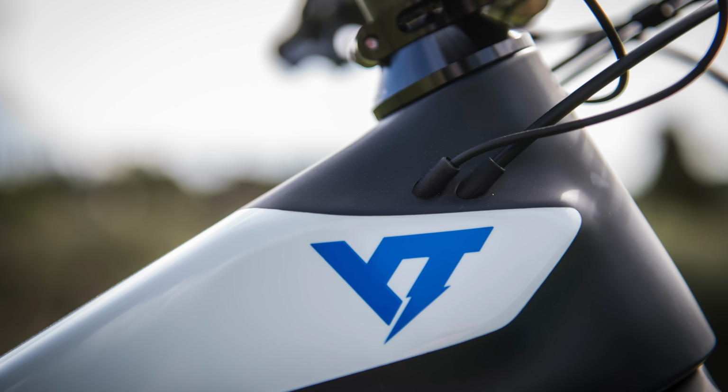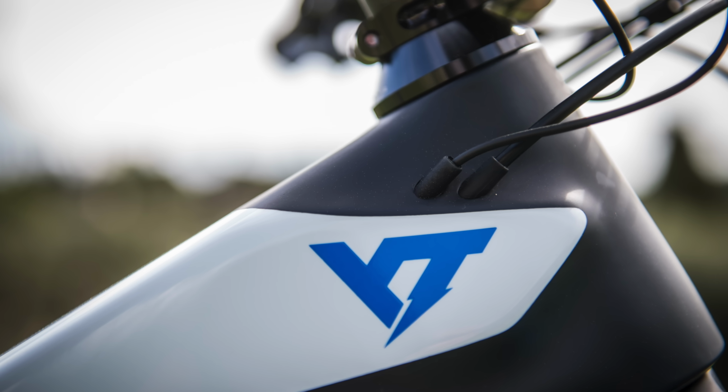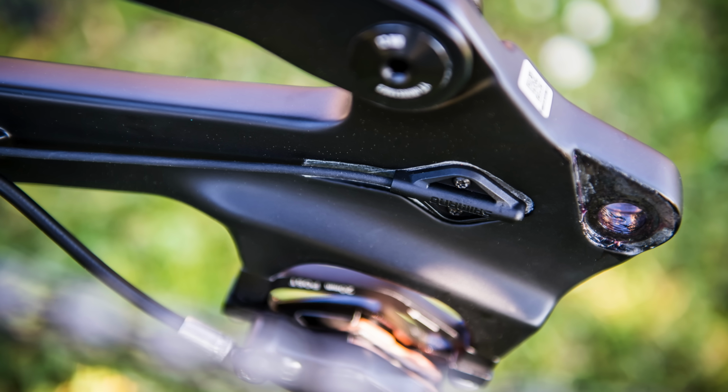Yes. So first, service is a huge topic. We had the service issue from the beginning in our design brief, because we go direct. So it's not all about the electronic issues you could have. It's also mechanical things. And we now have 10 years of experience, and we know what our consumers can handle and what not. And if we have a mechanical issue, maybe with a hydraulic system like a brake or shifting cable, whatever, it was clear the bike needs to be designed so that it's super easy to work on the cables, to change brakes, to change the speed sensor cable, for example. And that's why we developed a cable tunnel inside the bike.